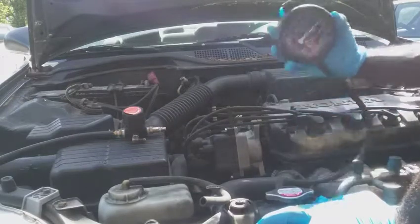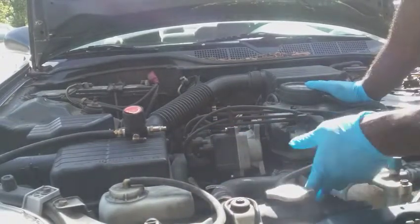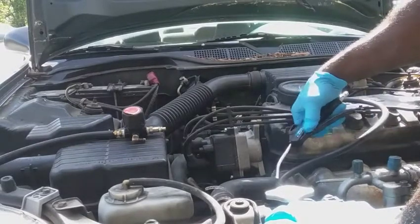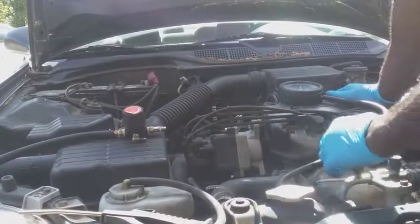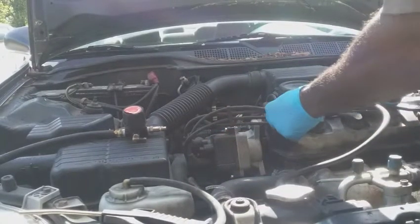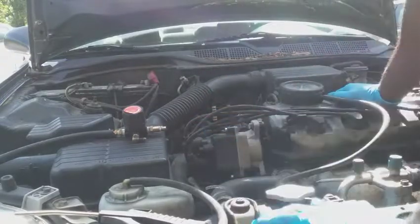After 10 minutes, I've still got 10 PSI in here. The hose is repaired. One other method I might use — if I didn't have my air regulators, I could just stick the air nozzle in here and submit air pressure to expand the system, but it's got to have a good cap. Anyway, this is done, so I'm going to drain the water out and move on to the next project.